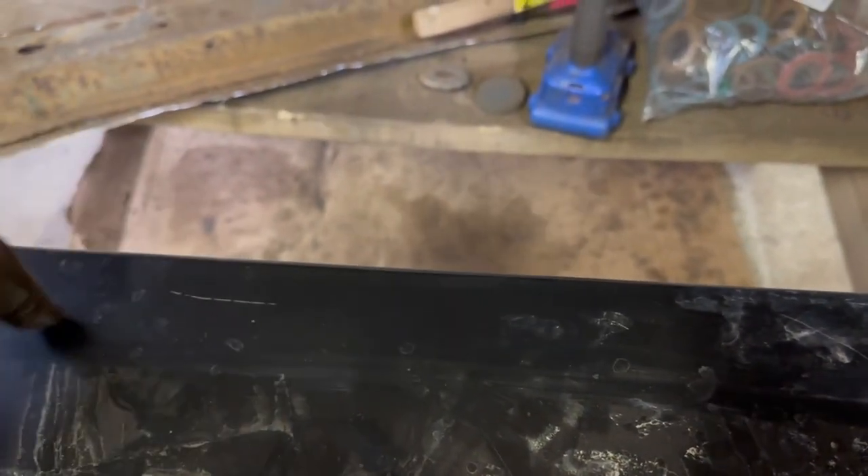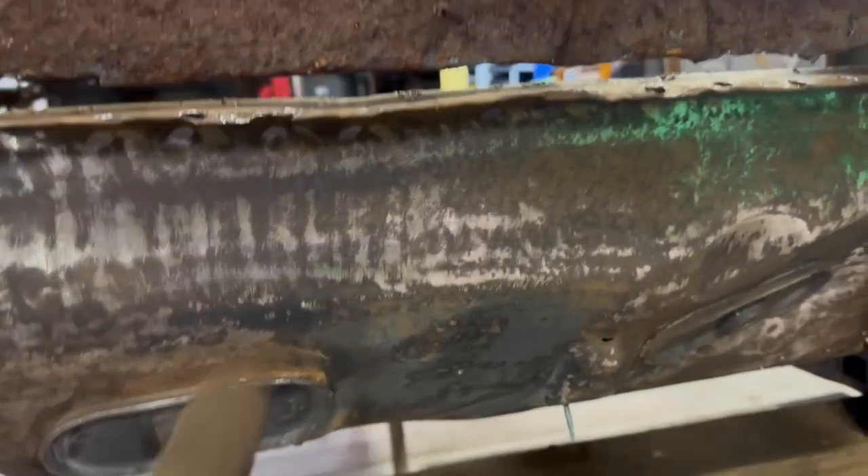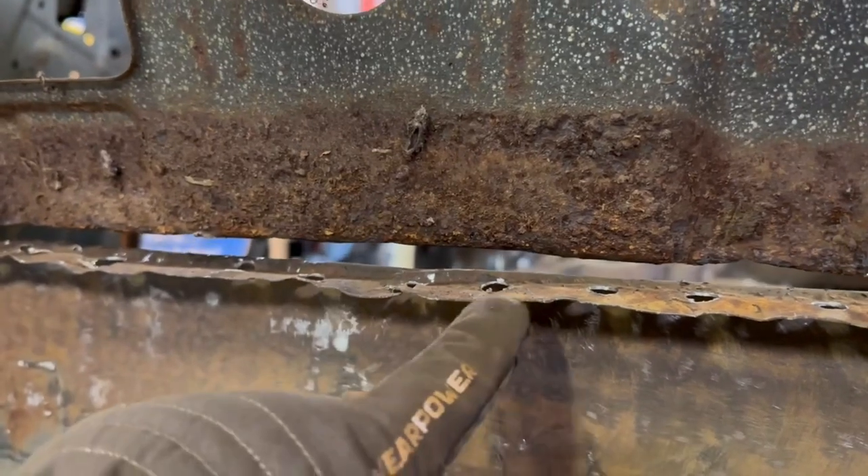What I think I'm going to do is take the piece I cut off that I didn't like, cut here, punch some holes with my hole punch, and probably just weld it on the other side. This new piece welded to this to replace this piece — so at least I have a nice true mounting surface to mount the new trunk floor on. Then it only leaves me the rear seat divider which is below the package tray, and that will need some work. I can always put another top layer of tin on the inside, and this all gets sandwiched together holding the trunk floor in between.